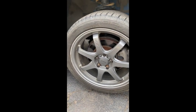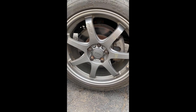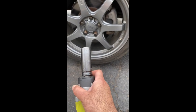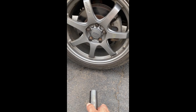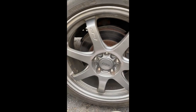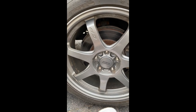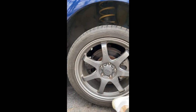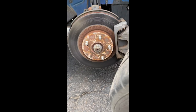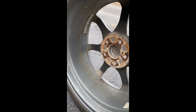Out of all my Hondas, this is going to be the most joyful oil change. Let's start by removing the wheel for a little more space to work. I've got my impact and a 19mm impact socket. Here's a little trick: I removed the lug nuts but the wheel is stuck — you can see from the rust it's kind of rust-welded itself onto the hub. Just give it a good kick and it should come right off. There's a lot of rust here, so I am going to be changing the brakes in another episode.